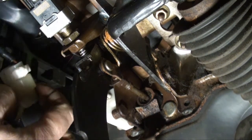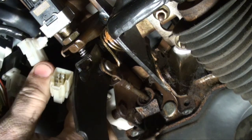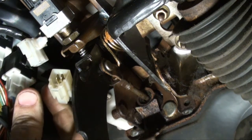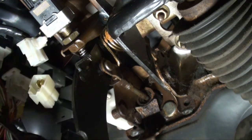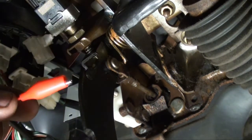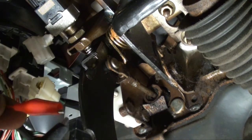So I got the harness pulled down. Let's unplug it. Actually, you know what? Let's use a multimeter to do a continuity check on this switch. And that'll eliminate it altogether. Let me go get my meter. Okay, I got my meter. I got my DVOM set to continuity. We don't need to look at the meter, remember, because as long as it's under 120 ohms or so, you should hear the audible signal. And just for an example, I'll take it in, as you can hear the signal.